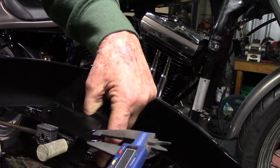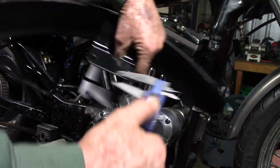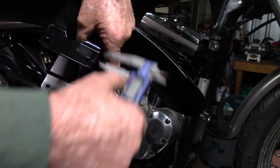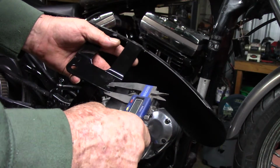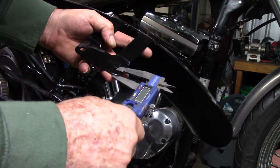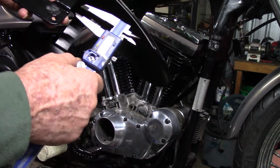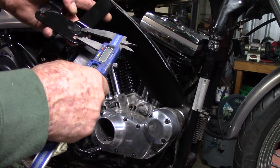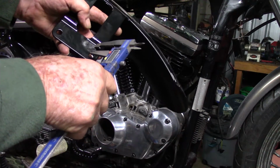Then, that's nearly correct. I eyeball the centre of the hole. And if this had a battery in it, I would zero it and then I go 5/8 of an inch, which is 625 thou or 16 millimetre. Actually, the distance is just a fraction more than that. Is that 5/8? Yeah. Don't copy me.